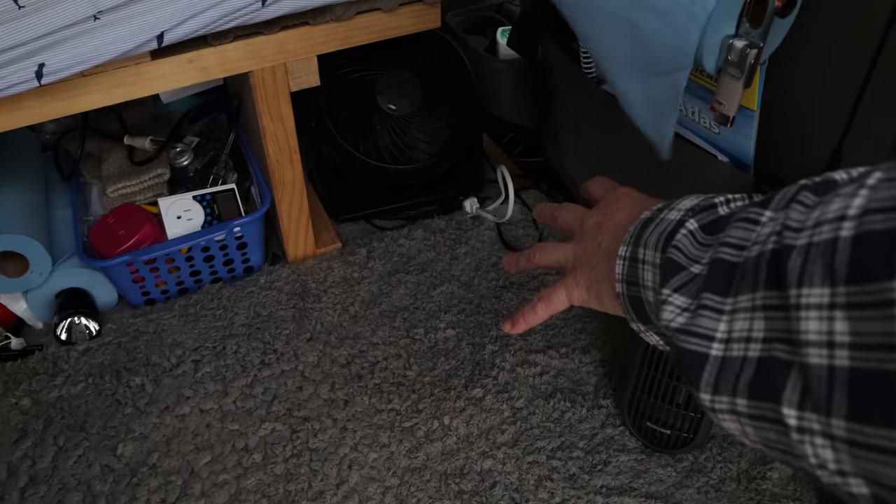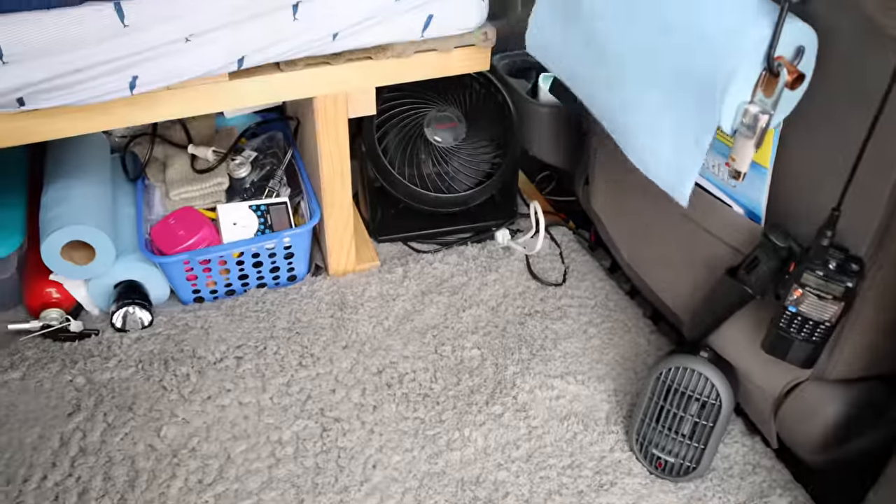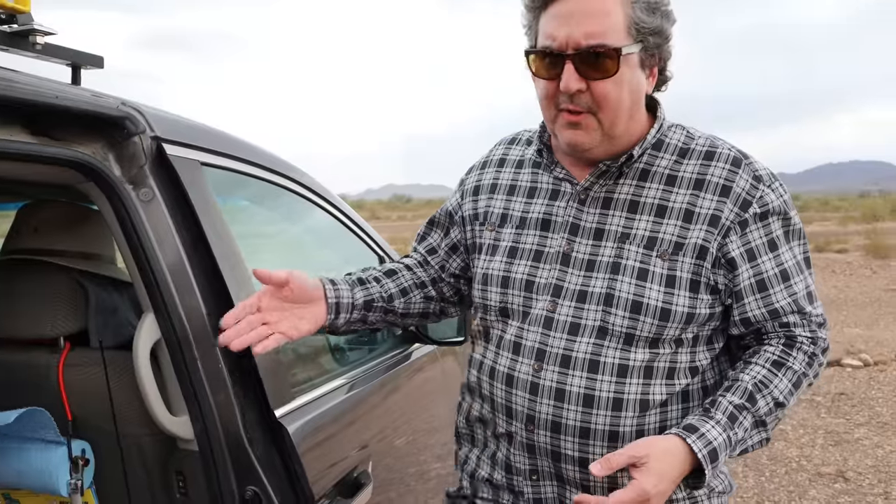They're all located below the floor so the viewer won't be able to see them, but if you go to my website you'll see more detail. I wanted to get them down where, if there was ever an accident, I don't have this giant 80-pound battery floating around inside — so it's bolted down well. I'm using the original fixed fixture points for the spare tire, and should anything ever be in a serious collision it's all going to go forward and under a metal plate that exists on the Odyssey. Circuit breakers and fuses at both ends.